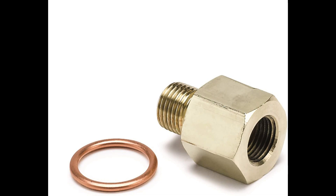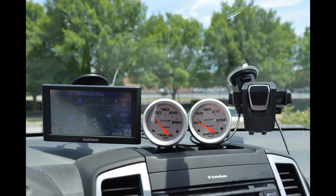After that it's pretty simple. Take the wire lead on the temperature sender, put a crimped ring terminal on it, and run the wire up into the cab however you choose. I ran mine up across and up next to the engine, and came in around on the driver's side through that big grommet boot, which is very close to the steering column. If you climb underneath your dash you'll see it, and you can just make a hole through there and bring the lead in. After that it's basically how you would hook up any other gauge — it's just power, ground, and the signal wire you just brought from the sender. It's really that easy.